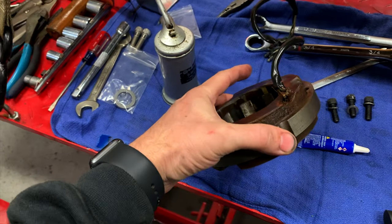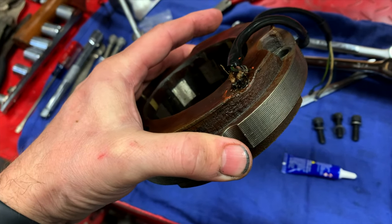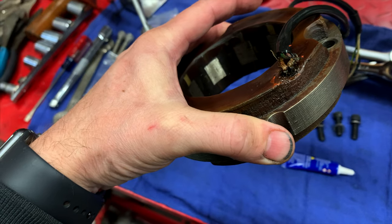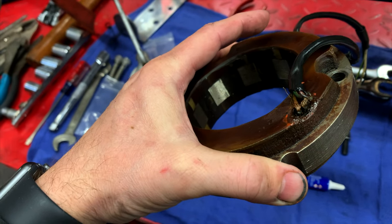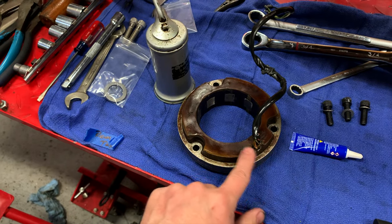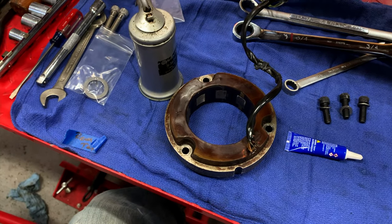This is a three-phase stator that I added - I bought it probably 20 years ago. You should be able to see the horrible mess that is the wires coming out of that stator. I've kind of repaired and babied those connections over the last probably 10 years. They crack pretty easily once they start getting hard because of all the heat cycles from the engine - the insulation gets brittle. At this point, short of taking all of this off and completely replacing these wires, this is just not worth continuing with, so I'm going to end up buying a new stator.